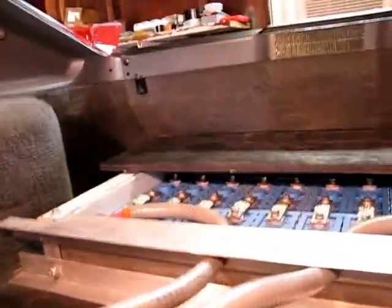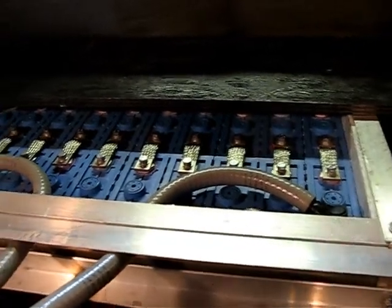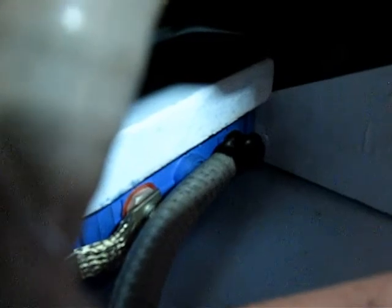So in here, kind of hidden down in there, is the negative side of the battery pack, this little 4 battery pack, and they're strapped together. Again, it's really hard to get the camera in here, but I'm trying to give you the best view I can. So that's the positive connection, and it just goes up this cable here and into the rear battery box and hooks to the negative here, because you're always wiring positive to negative. And that other negative lead, again showing there, is what goes out to the front engine compartment where the front battery box is. So anyway, that's the whole wiring here.